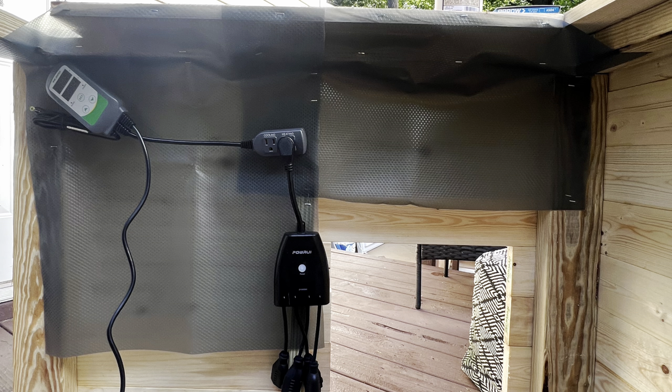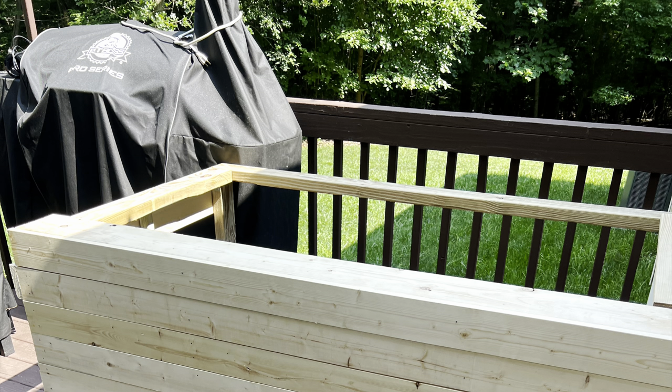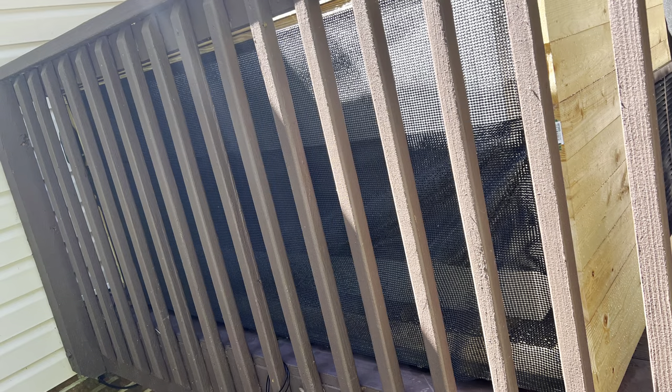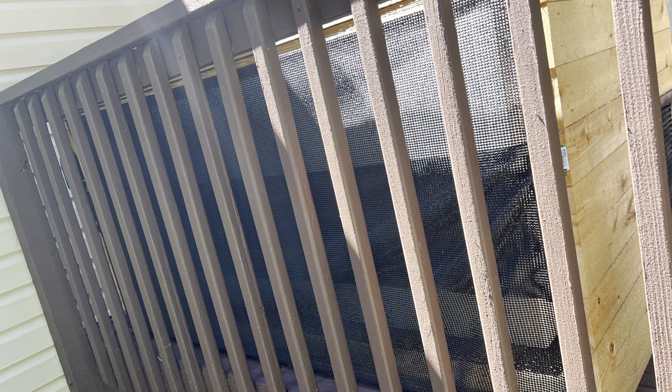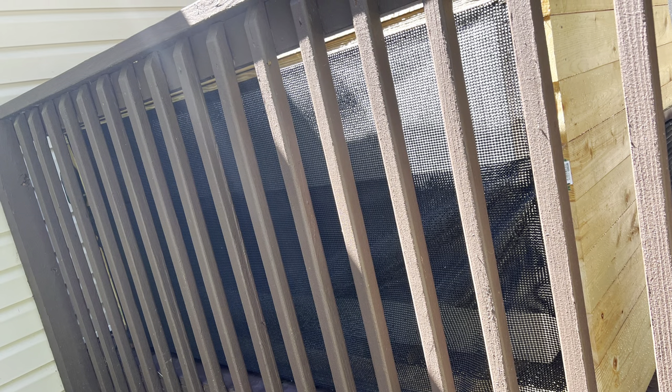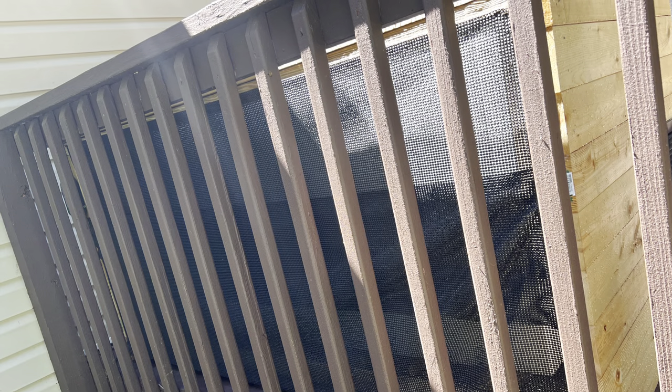Screw everything up to your board. I've got my Inkbird temperature gauge and my surge protector mounted there. Map it out and plan it so you can get everything set up and ready. Then remove the backboard off the back of the frame, place your chest freezer where you want it, slide the frame and enclosure around it, and put the backboards back on to close it in. The back of my freezer is open — I've got cabinet liner mesh on the backside so the freezer can breathe, and it's easy to remove if I need to access the freezer.